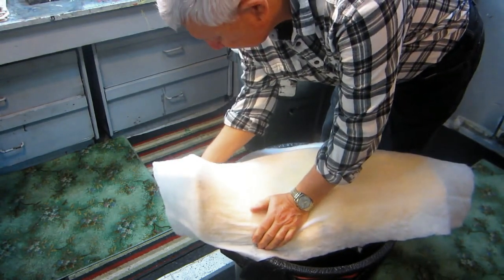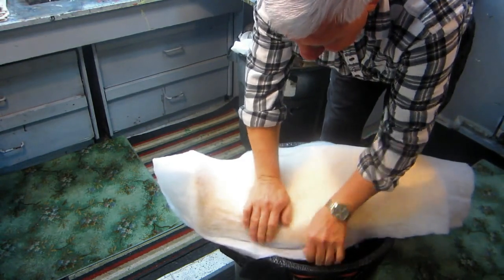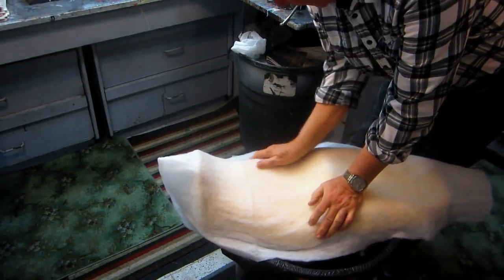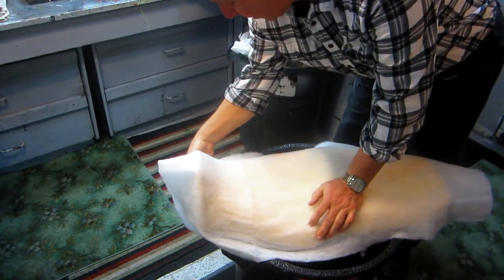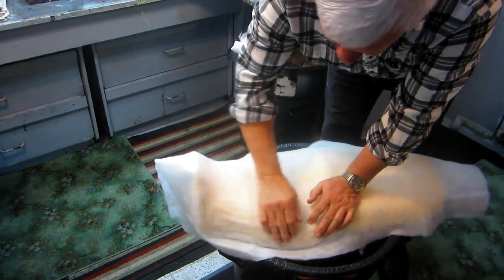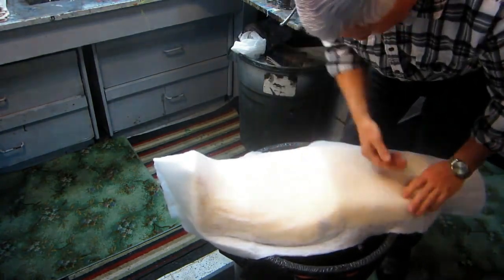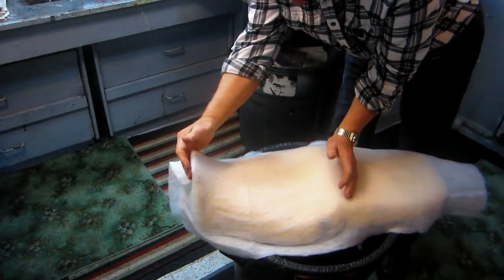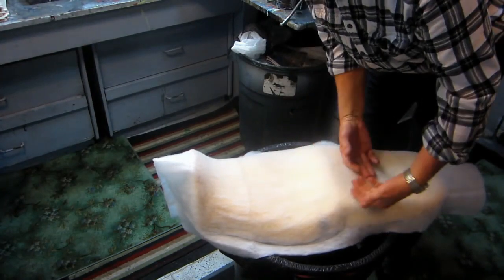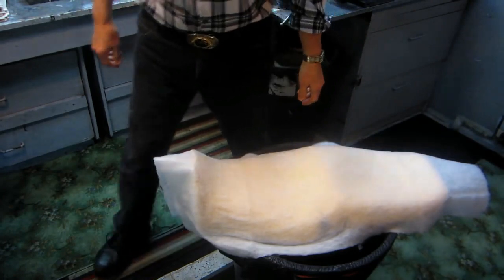The contact cement just very gradually, as it's setting, gets stickier and stickier. You can get out some or all of the wrinkles. If you wait too long, the glue gets to where you can't get it to hold down. And you don't want to do it immediately, instantly. You want to have about a 2 minute window, I call it a 2 minute time window for me. Now we're only going to see this part of the seat, so lucky for us we don't care if anything, but this is the easy part. So the only part of this we're going to see is the hard part, of course.